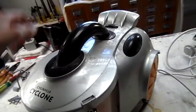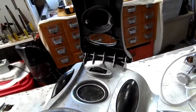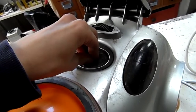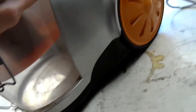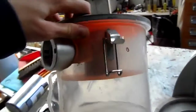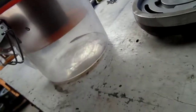It's basically just from a generic line, but we'll pull it apart, get the motor out, and see how well it's really built. The air intake is through here, and this must all be hollow up here — you can actually see daylight. So it draws air in through the front, through the filter, through what's called a cyclone, like what's used on a dust extractor. It basically spins around all the rubbish that it draws up.